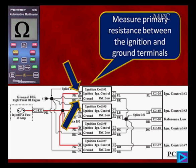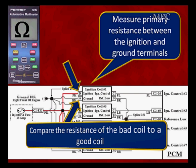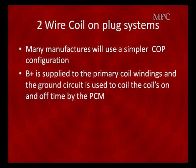If all coils show low primary current, check the primary resistance. Measure ohms from pin A to pin D on this vehicle and compare a bad coil against a good coil — that's the best approach. Because different vendors supply parts that aren't identical, comparing coils directly is safer than relying solely on spec values. With four coils right here together, it's pretty easy to measure.